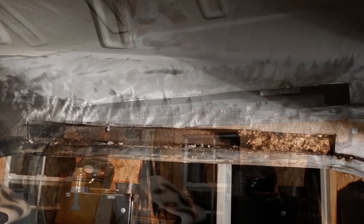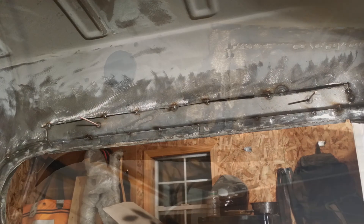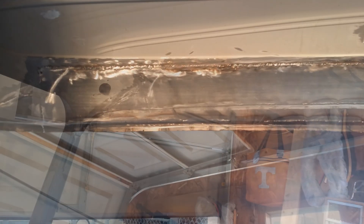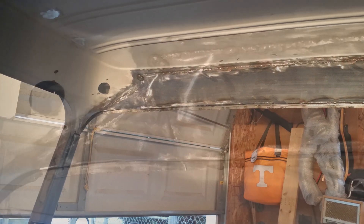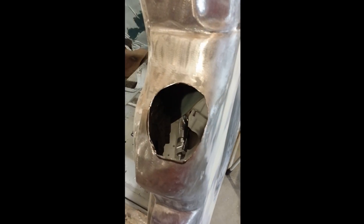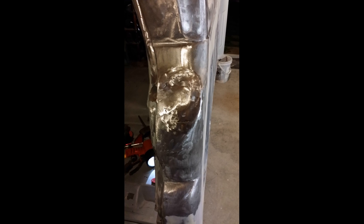That's pretty nasty there - that's like a rat's nest. Believe it or not, when I cut that out that's what I found up in there, so you never know what you're going to find in some of these old trucks. Before welding up those patch panels I actually treated the bare metal with some rust inhibitor encapsulator from Eastwood. One thing I do like about that encapsulator - whenever it turns black, that's when you know all the rust is gone and it will not come back. This was another tricky part - the gas cap filler neck - because it's on an elbow. I don't have an English wheel but I do have a shrinker and stretcher. It took me several tries to get that formed, but I was able to get it.